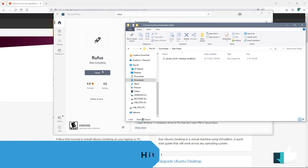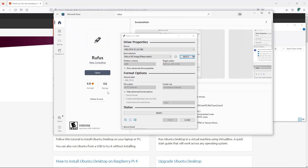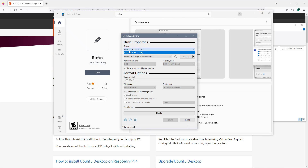We're going to open up Rufus. We're going to allow it to make changes to the computer — it'll give you that dialog box, so make sure you click Yes. You're going to want to make sure that USB stick F is selected. Before we begin, ensure that the only USB stick, SD card, or anything like that in the computer is the one that we want to make bootable and wipe. So make sure you unplug all other USB sticks except for the one you want to format. Under the device dropdown, make sure that's the 32 gigabyte USB stick we want to format.